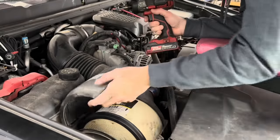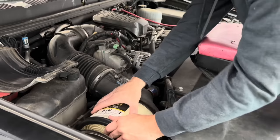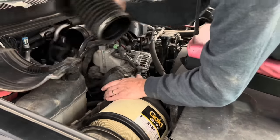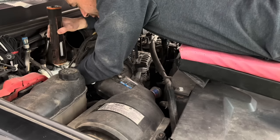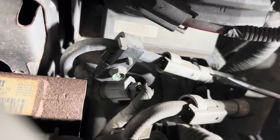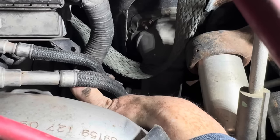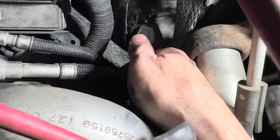Now in your case where your pressures are all over the place, we would want to really start looking very closely at the actual fuel lines, the sending unit, and that sort of thing. I know you had mentioned that the sending unit's a little rusty - is that correct? Yes. So at that point, we would start looking into that. For a real world scenario, we just had - I want to say it was either a 7.5 or an 8 - that came to the shop not that long ago. From what I gathered, the truck had come in with extended crank issues. The tech ended up actually finding that the sending unit was all rotted at the top. Even though it wasn't leaking and you couldn't push your fingers through it, it was still an issue. We put a new sending unit in it and it fixed all those issues.